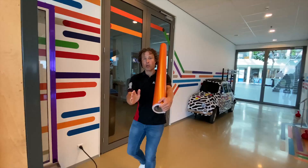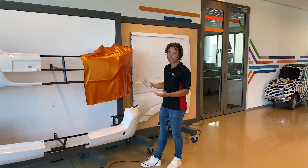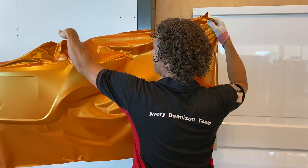I am going to show you a few simple and solid techniques. There are other methods that you can use. Bumpers and mirrors have more complex and extreme shapes which lead to more tension. How you divide the tension is very important. Pay attention when you start positioning the film. If you choose the most straightforward method, in many cases you might create tension somewhere else.